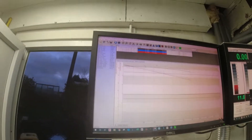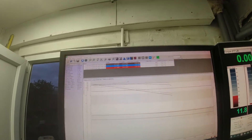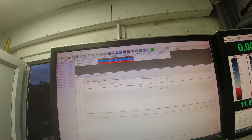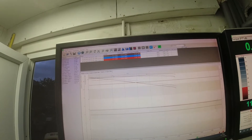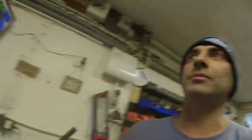So that's three runs done. You can see from the graph we've got 6.1, 6.2, and 6.1 horsepower, and torque figures of 12.19, 12.26, and 11.68 foot-pounds. Those results are pretty consistent. The engine looks pretty healthy but a bit low on power — I think it's time to strip it down and turn it into a monster.